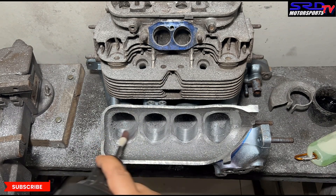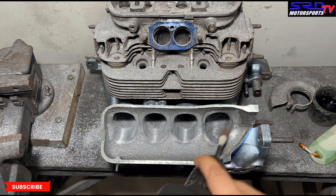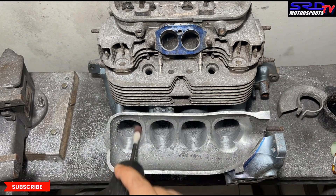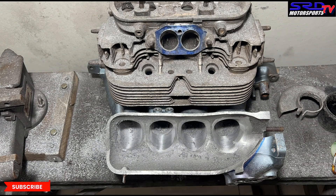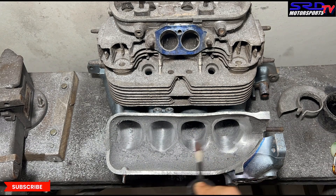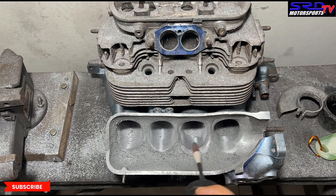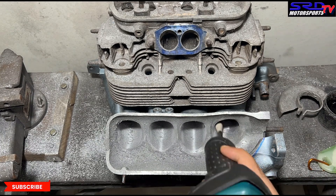It's not uncommon to smooth it out with 80 grit and then suddenly notice some areas where you need to go back to the carbide — and that's fine, just go back to it and get the shape you need to achieve. We're starting to taper the initial inch so it's going to be more tapered consistently. Once the initial inch is consistent, we go even further into the runner so the gradual taper is consistent. It has to be consistently gradual tapering — it cannot be different sizes in different areas. This is what works for me.